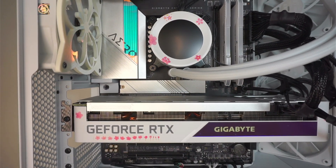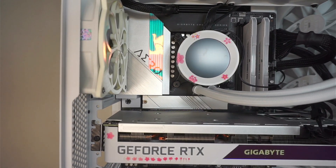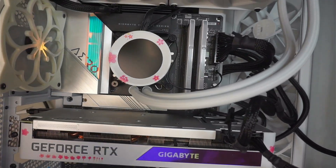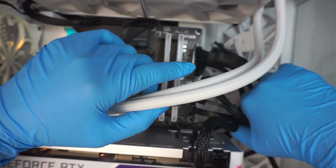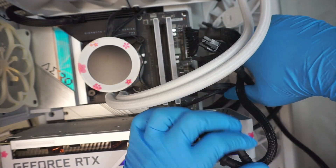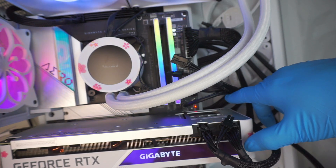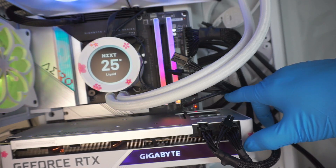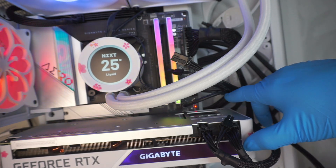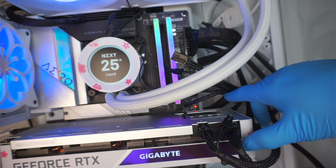Let's turn it on again. Let me get the power here. Let's power it up. Let's pay attention to the light on the motherboard — there should be a light somewhere right about here, but the wiring is blocking it. I hope you guys can see the light. Let's turn it on. Looks like it's going through some steps — and it's still stuck at VGA light. I know the graphics card is working, you can see the light is on and the fan is spinning. But there's no display.